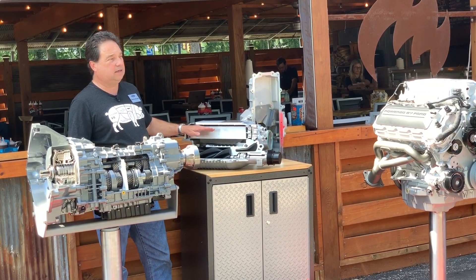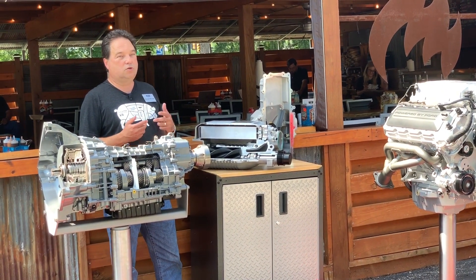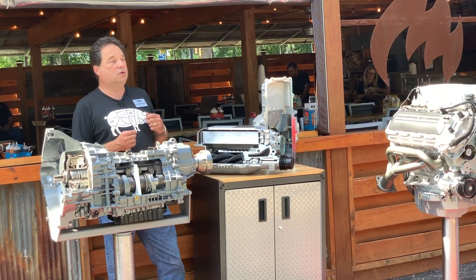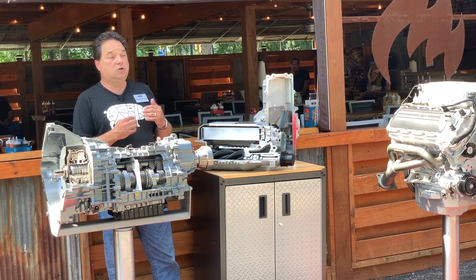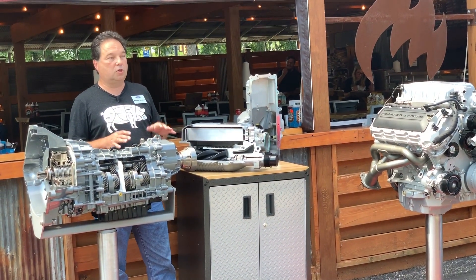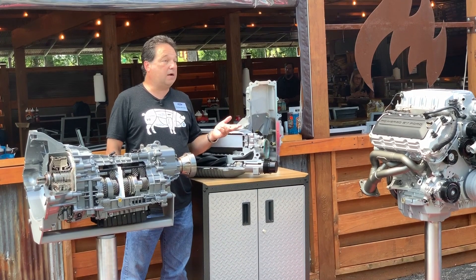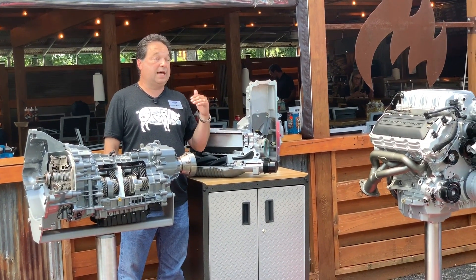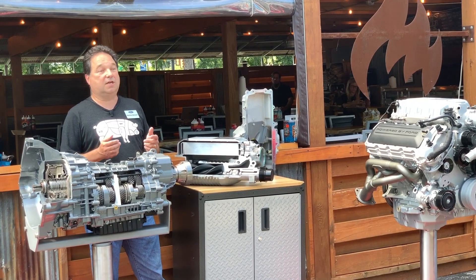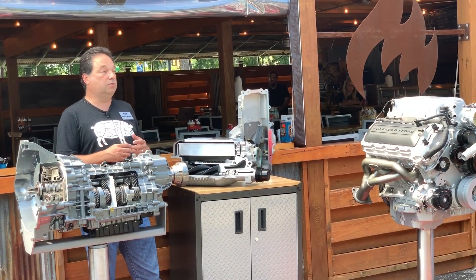The intercooler is sized so that we don't get any heat soak, giving you consistent performance for an entire session on the track. When I say an entire session, you can run this car out of gas and you'll still be getting full performance. It's an air-to-water intercooler with its own low temp cooling loop. To get maximum time on the track, we also made changes to the fuel system that allow us to run the fuel tank completely dry. With 1.5 G corner loads, we've got a jet pump plus a couple of fuel pumps to manage fuel flow and allow us to use every drop of fuel.